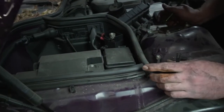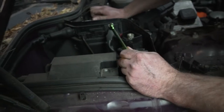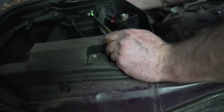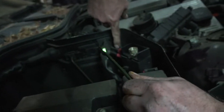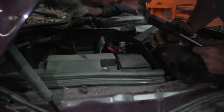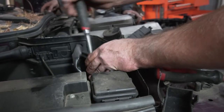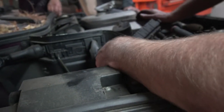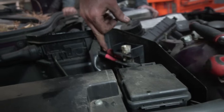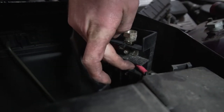You're going to go over to the main power terminal right here. You'll see we've got a couple little rubber guys coming off, and basically these wires right here go to the alternator and starter. So here and here and here — we've got to disconnect those three, and it looks like we just need a 10 and a 13. On this one there are two 10s and one 13. The top one on the largest wire — this one is a 13, this guy is a 10, and this one is a 10. Once you get it off, they just come off.